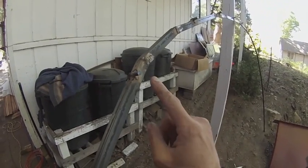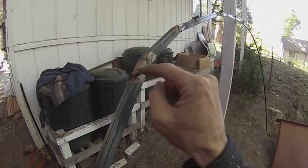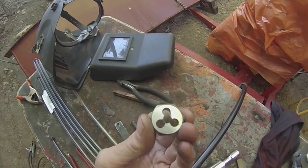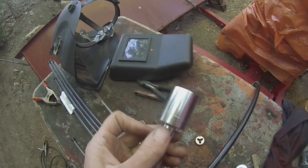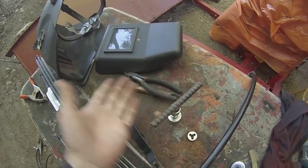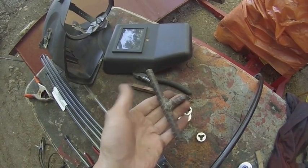As you would expect, when I cut it with the grinder and the cutoff wheel it buggers up the threads, so I have this — which is a die to recut the threads. This fits right over it. It's a one-inch socket and then I made this tool just to make the turning easy. You can get a tool like this for eight bucks but I could make this for free in less than five minutes, so I figured why not.